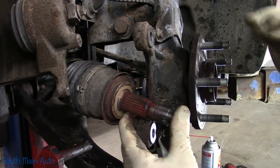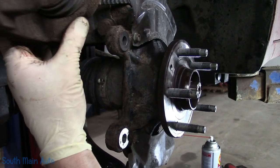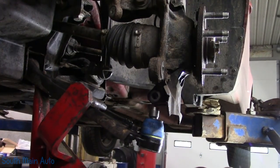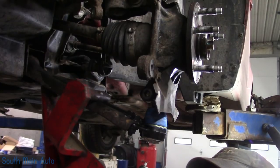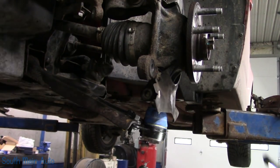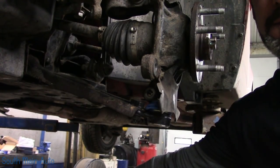And then when we're right here, give her a little shot of fluid film in there. We'll pull her back. Line her up in the hole. Wiggle it in. Move our caliper. Get control of the stick. Fluid film up in there. All right, make it easy for the next guy. Line that up. Down. Get a real hammer. Just very ginger. No, don't go crazy. Line up the slot. Once that's lined up, then we'll stick our bolt back in.